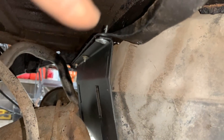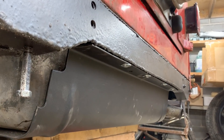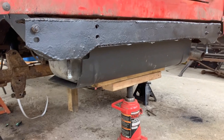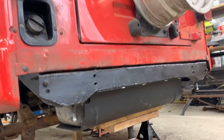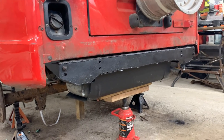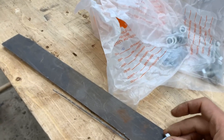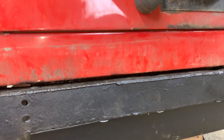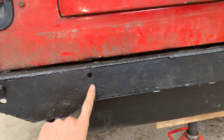I'm gonna replace the hardware — put nice bolts here. On this side, somebody said I shouldn't trust self-tappers, but I think they'll hold pretty well. I built and repaired limousines and I've seen them 10 years and older using self-tappers on the frame to hold different stuff — they are not going anywhere. The metal I used is 12-gauge sheet metal; once a self-tapper makes its way through that it's gonna take 20 years before something happens.